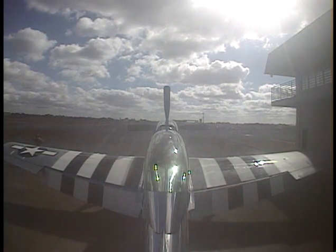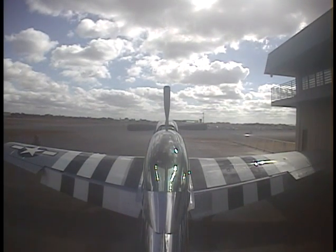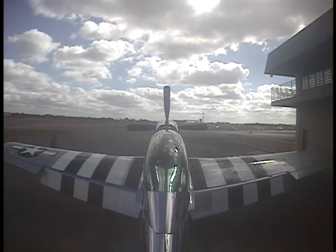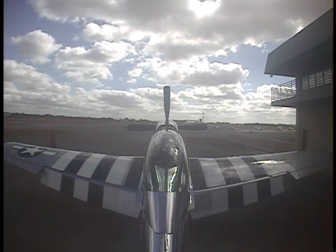I do. Cool. Coolant door's coming to automatic, so it's going to drive all the way shut. Make sure it's idle, cut off, throttle's cracked, props forward, mags are off. Fuel computer's reset. Listen to radio 1 and 2, we're transmitting on 2. Oil door's going to automatic.